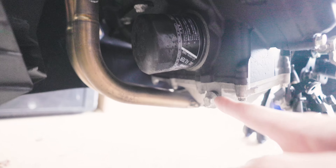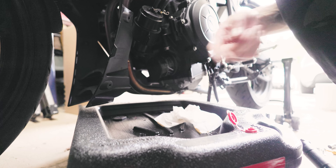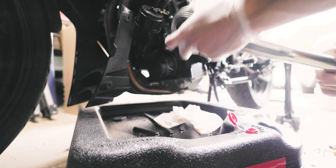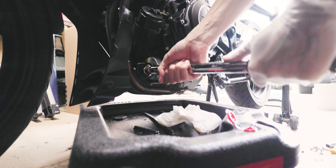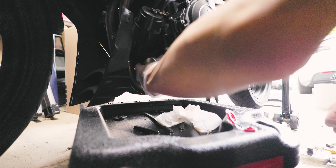Looking on the left side of the bike, down here is where your oil filter is, and that's the drain bolt — that's a 12 millimeter. I'm going to pop on a glove so I don't get oil all over my hands. I already have the drain pan right underneath to catch the oil. Take your adapter wrench piece and just fit it over the oil filter. Once you crack that loose, you should be able to just twist it off by hand.